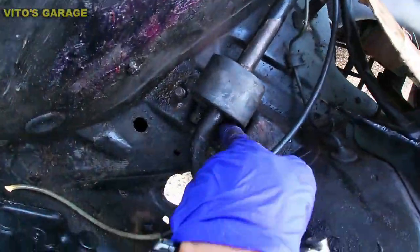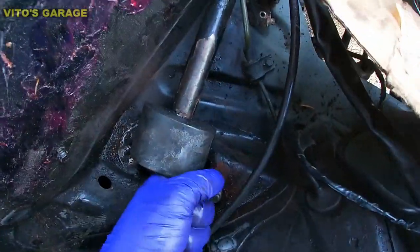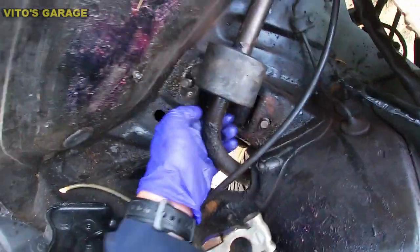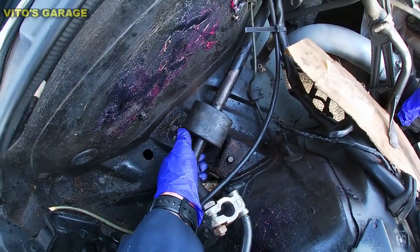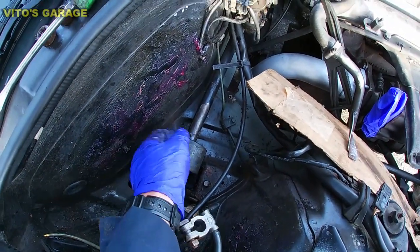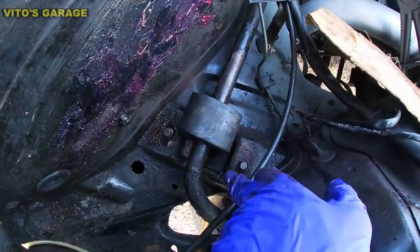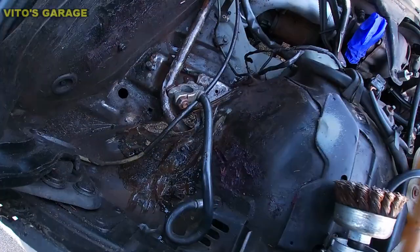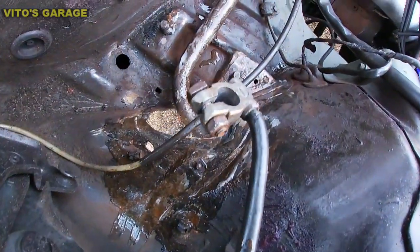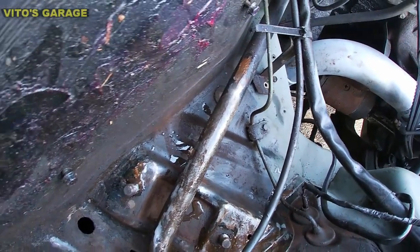Since this was disconnected, I'm trying to move it by pushing it, and you can actually open it too. This whole sway bar kind of moves up and down, so you'll have clearance to move it. The reason I want to do this is because I've got to clean all this rust off and treat all this area. This is cleaned up pretty well — not finished obviously, but right now I'm soaking it in rust dissolver.